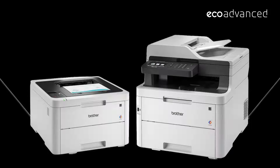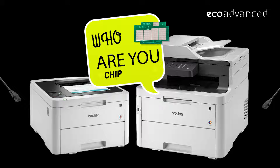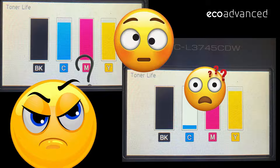By taking the power cord out, the printer is dumping its memory of what cartridges are in there and it forces the printer to re-interrogate the chip and look at the cartridge to reset itself. A low toner message does not mean change the toner. Changing a toner when the printer is not asking or expecting it can confuse the driver and the levels don't get reset.